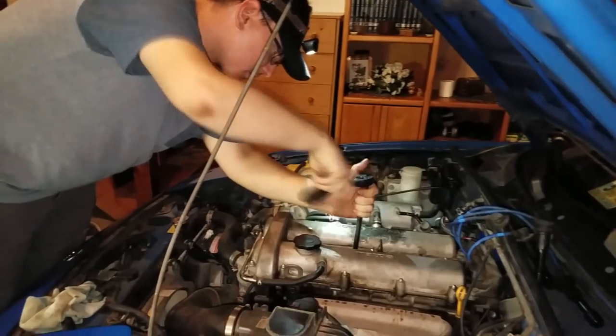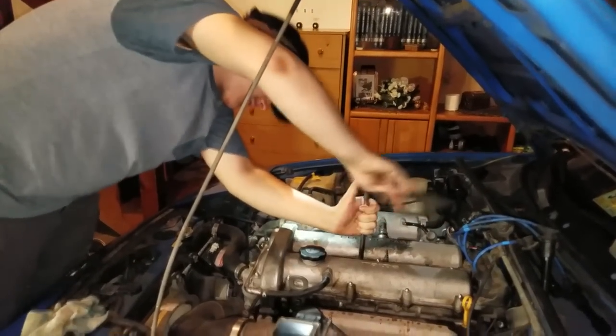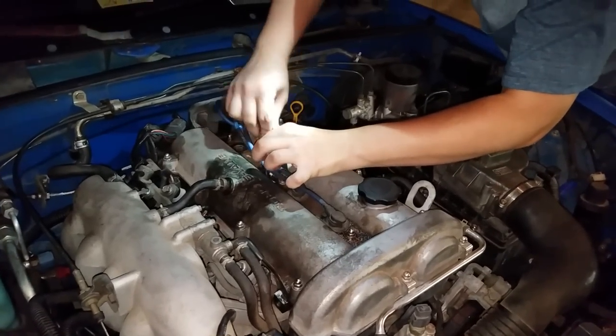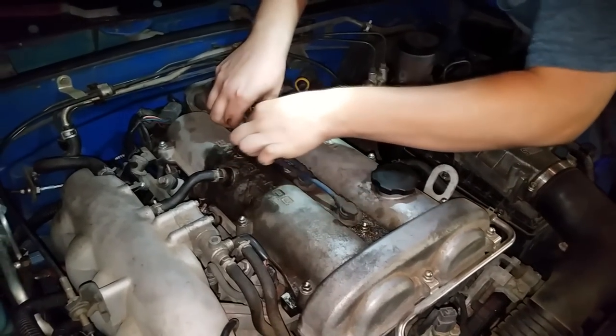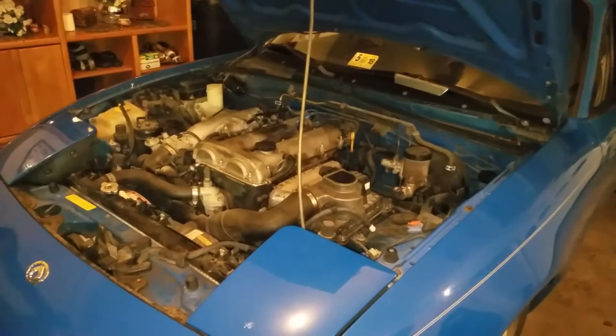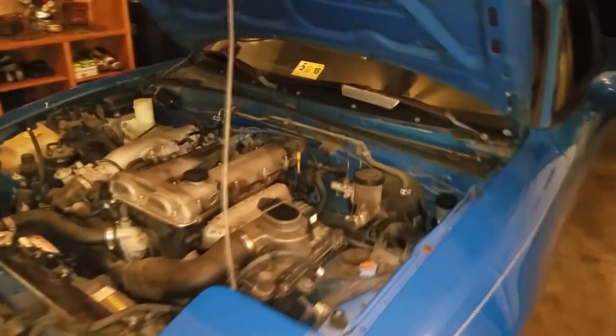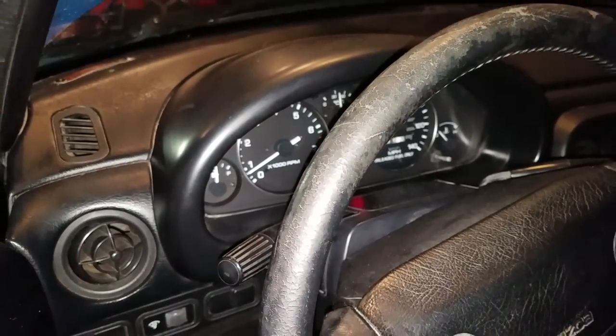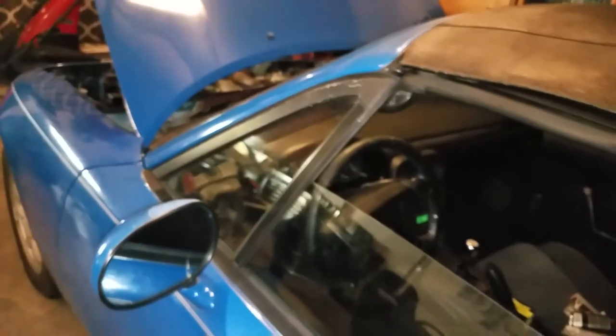Work harder, Dino. All the new NGK spark plugs are in. We're popping on the NGK coils now. Sponsor us. So it seems to be idling better also. It's smoother. The idle did fluctuate sometimes, but it seems pretty rock solid right now.